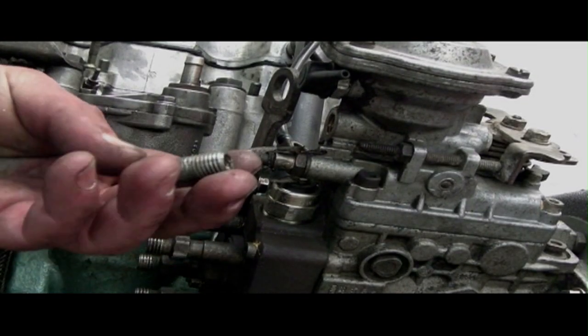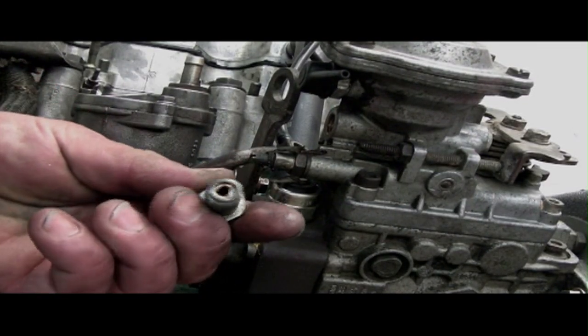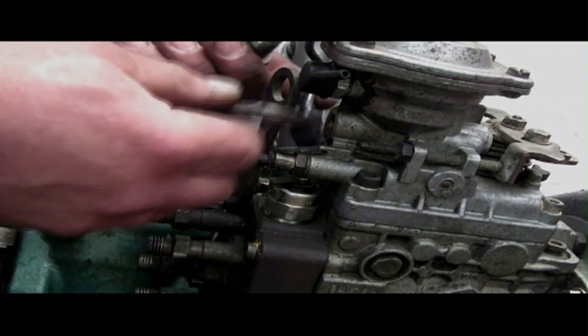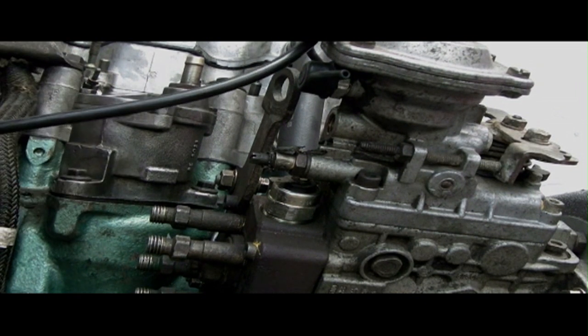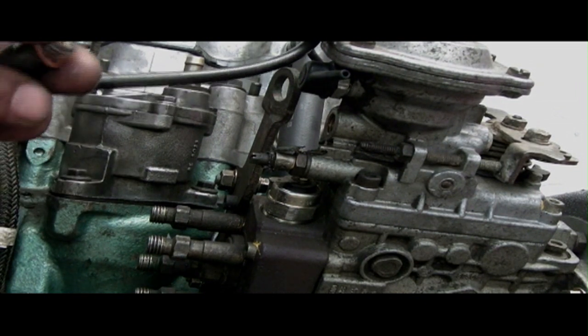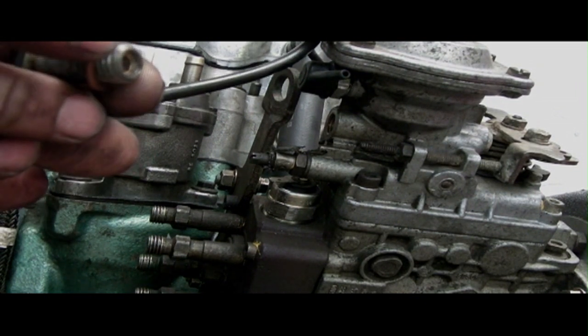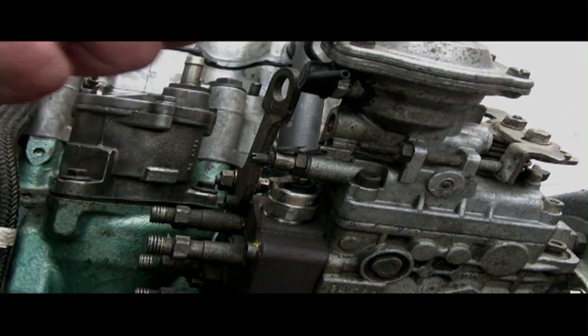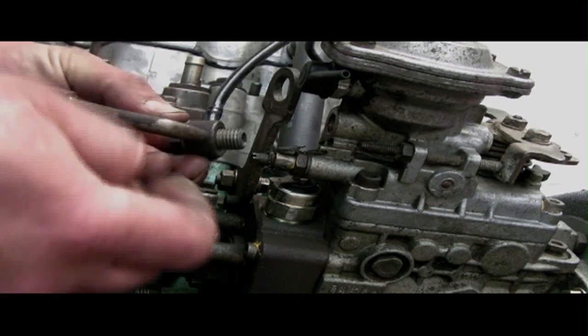On the rear end, this one has a filter and a small pinhole and fits on the back here. The reason this is restrictive is to actually keep diesel in the fuel pump, and the filter is to stop anything coming back up the other way — it's logical.